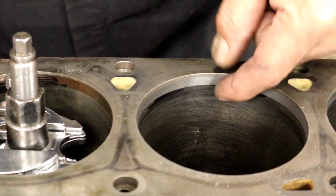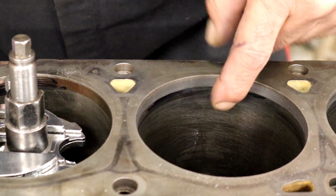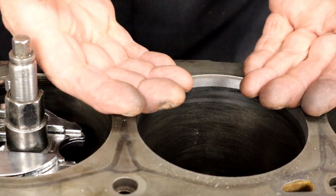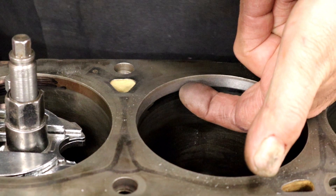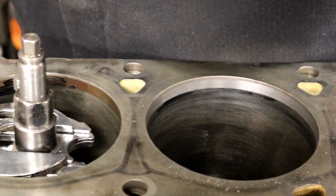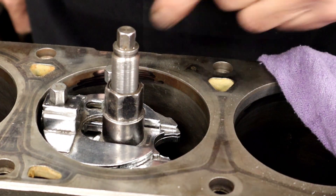I've just cut the ridge — the bore hasn't been touched at all. The blade lays flat right up against the cylinder wall and doesn't do anything until it gets underneath that ridge, then it just cuts it off. Let's go over here; I've got two more cylinders to give y'all a little bit of insight into what's going on.